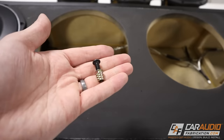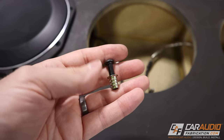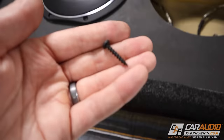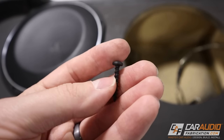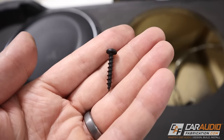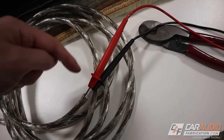With the wire completely prepared, we now need to mount each subwoofer into its mounting hole. In the past I've used threaded inserts along with machine fasteners — the advantage being you can take the subwoofer in and out of the box several times without degrading the quality of that hole. In this video, I want to talk about best practices when using wood screws to mount subwoofers. These are pan head screws — not coarse thread drywall screws. Don't use drywall screws because those have an angled head. Try to get pan head screws in black so they blend in with the sub. Before mounting, connect the wiring and use a multimeter to verify the ohms value as you connect each subwoofer.